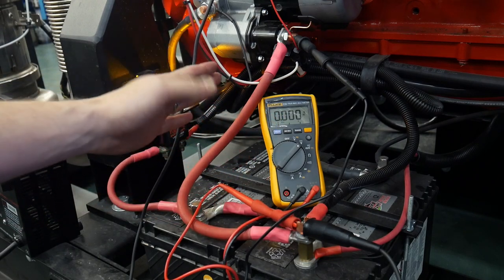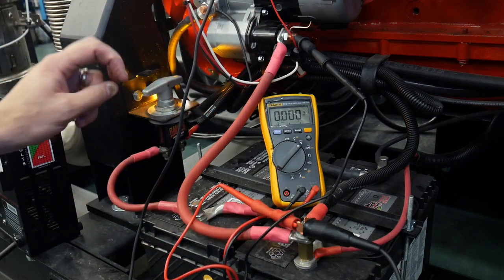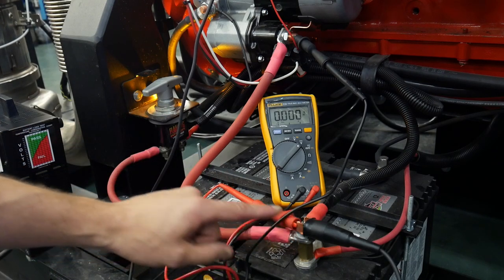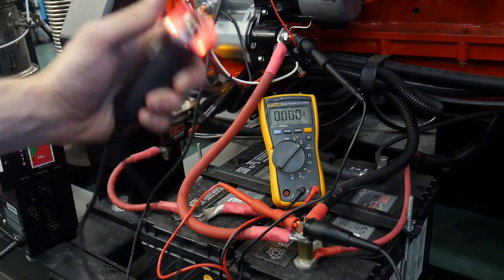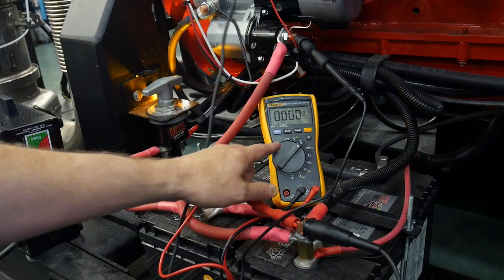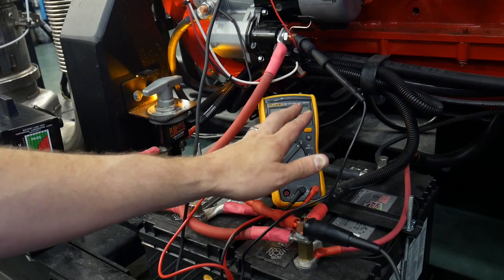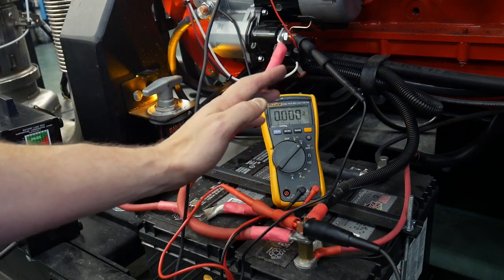The spec in your book explains that between the positive and negative cable, if we add both voltage drops together, the potential consumed across those cables is 0.5 of a volt on a 12 volt system and one volt on a 24 volt system. I'm going to hit the start button and use the min/max button to help me record the maximum voltage difference from this point to this point.